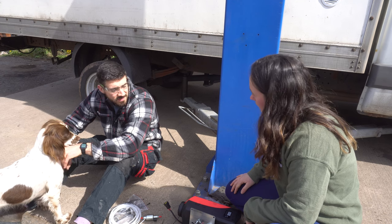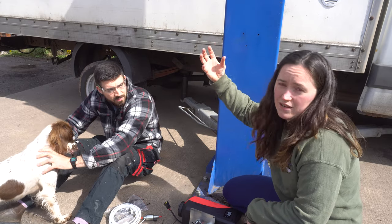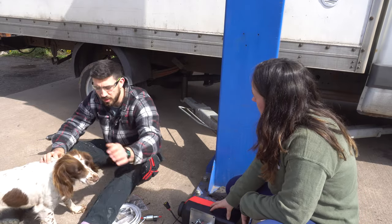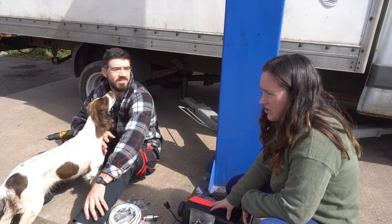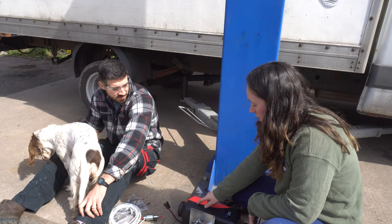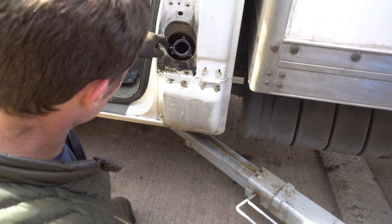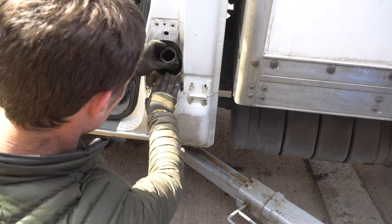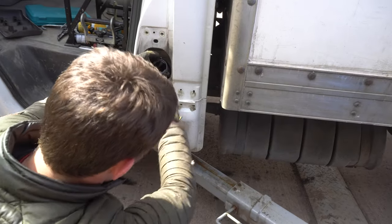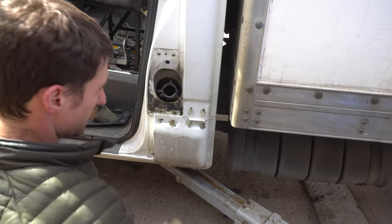At the moment it's just figuring out where we want the hot air to go up through the bottom of the van. This is hopefully the last hole we drill through the bottom — well, we've got to put a hole in for the waste water too, so one more. We should have hot air coming to a van near you soon. We'll drill the hole here because this is the highest point — if we ever fill the tank full of diesel, it's still above that level whereas all this could potentially be below that level and full of diesel.